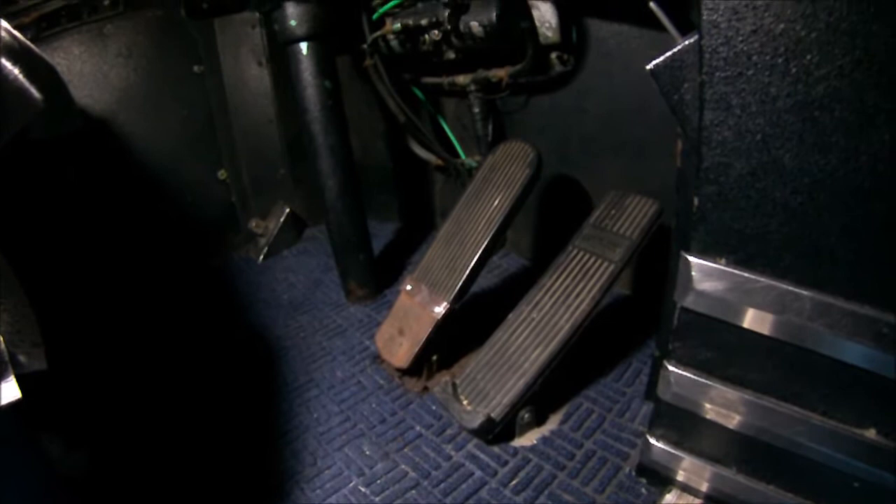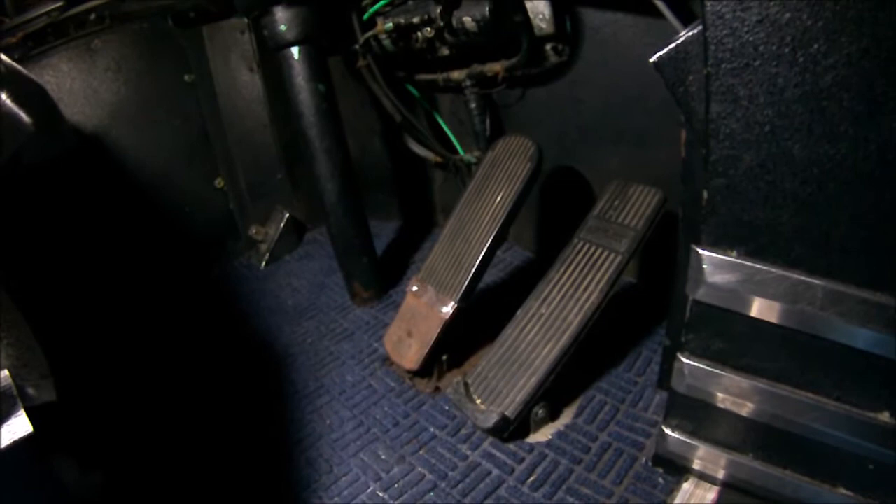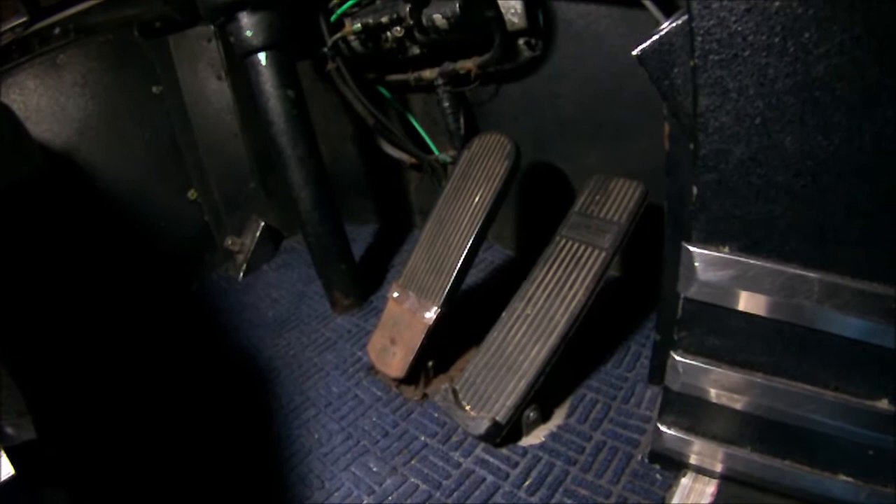Today's project is to figure out what's going on with my brakes. When I step on the pedal, it kicks back a little bit, and I can watch the stoplight switch not engage. I can feel the front brakes catching, and then if I step a little bit farther, the rear brakes come on and the stoplight switch engages, which operates off the relay valve near the rear axle against the bulkhead.